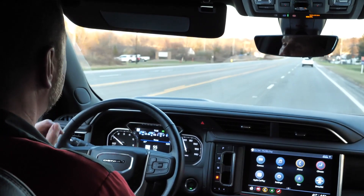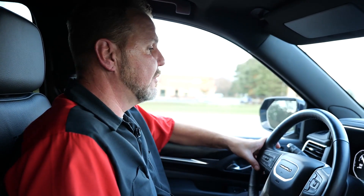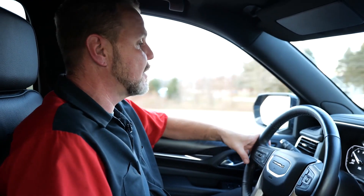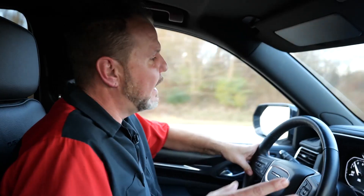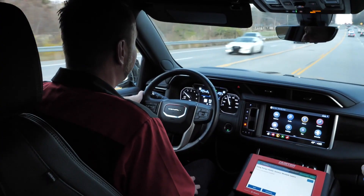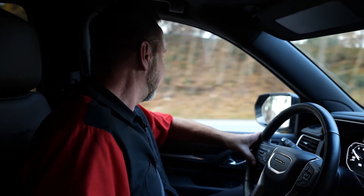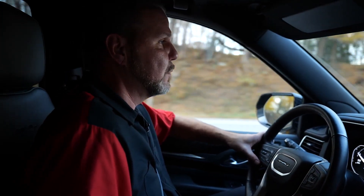There is a car in front of us. The dash is indicating that our adaptive cruise control is set to 61. It reads the car in front of us, and we have backed off our speed according to the car's speed in front of us. We have verified that the system is operating as designed, and we can safely return it to the customer. Thanks for watching this video covering the front radar calibration on this GMC Yukon Denali. Stay tuned — next time we'll be doing another calibration on another vehicle.